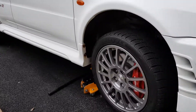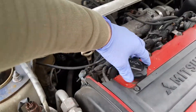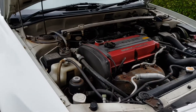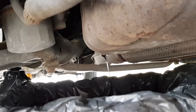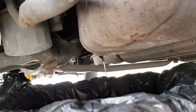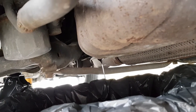The car's all jacked up now with an axle stand underneath. Get the oil filler cap off, dipstick out, get under now and drop this oil. Engine oil is trickling away. Should have jacked it up on both sides really but live and learn I guess. Oil filter's next. Anyone wondering — it's a 17 mil spanner to get the sump plug off, and that tool I've just bought is a 17 mil socket on the end of that as well.